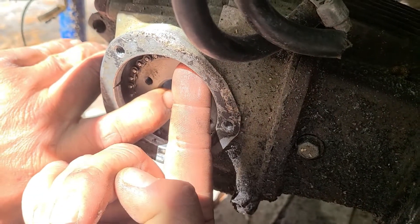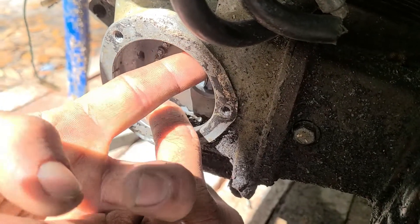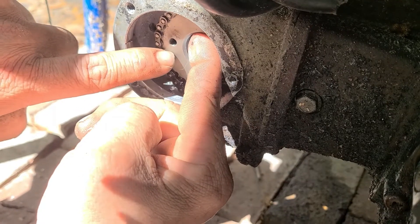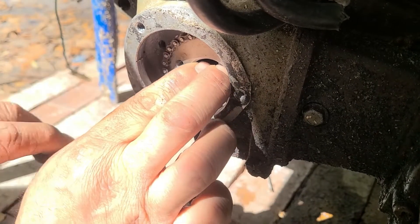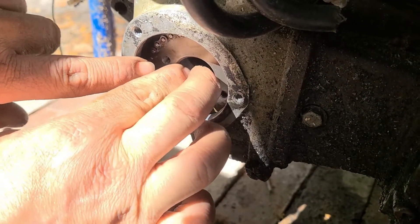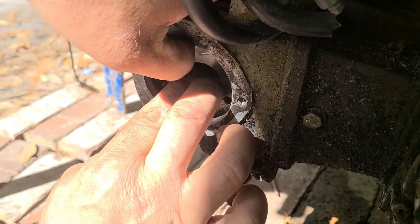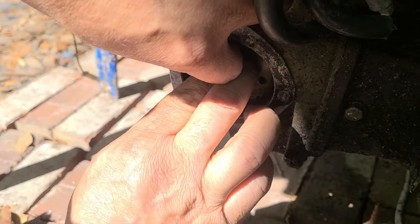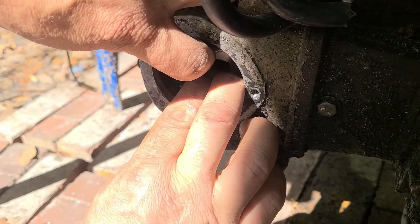So what you're going to do is stick one finger up here. We're going to do the bottom — roll it up. Off of the chain, just a hair. And we're going to go one, two. See, it's a little tedious. My hands are awful big. What I'm going to do is hold this chain up — I'm going to pull this sprocket away from this chain. If I can. There it is.